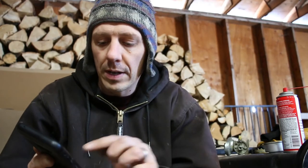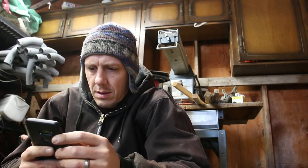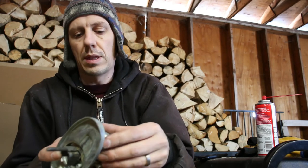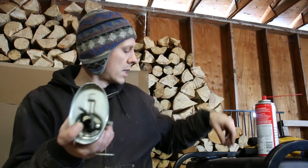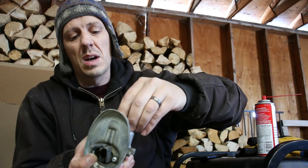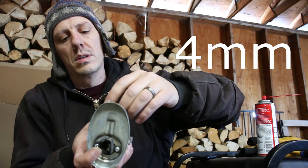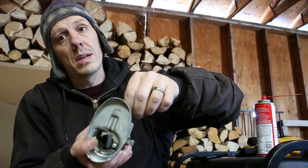We're gonna look this up, see if I can find anything. Well, I didn't find anything really useful on what that little hole is. I think it's an idle vent or something like that is what it said. Couldn't find any specifications on whether it should have something flowing through it or not, but I did find that my float is supposed to be at 11/64, and it was at a half inch. So I adjusted the float. Maybe that's all I need to do.